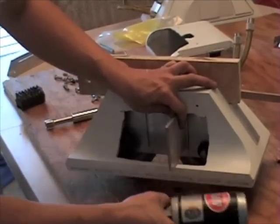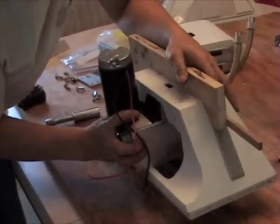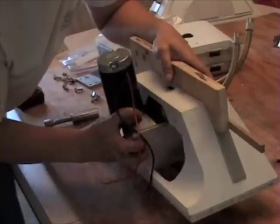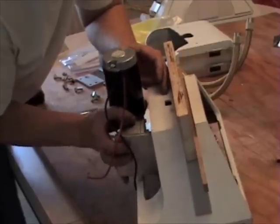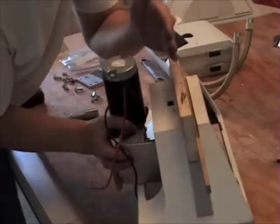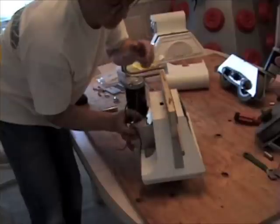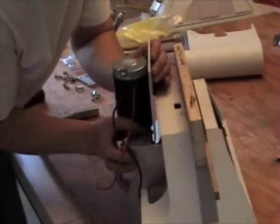What I'm going to do is place the motor in here. To know where you're going to position your motor, you're going to place it on the bracket. Make sure it's up against the drive train housing — the bracket is against the drive train housing. You want to move the motor in slowly. The only distance right now we're concerned about is between the motor and the foot shell. I don't care about up and down yet, I don't care about side to side. We're just determining how close this motor is going to be to the foot shell. My battery box here is 1 and 1/8 inch thick, so I want a little more than 1 and 1/8 inch right here.